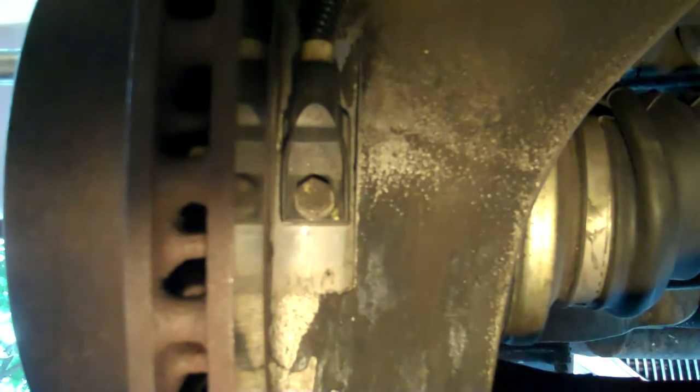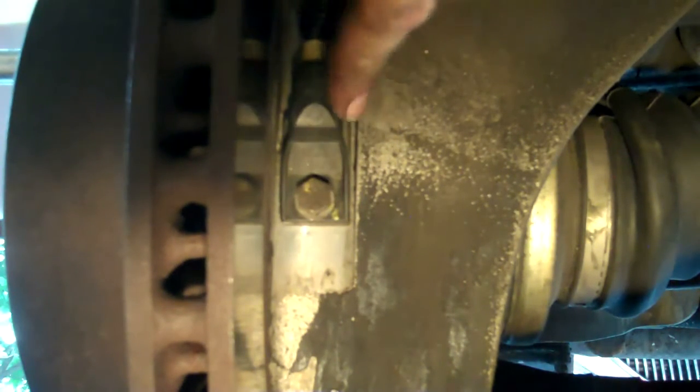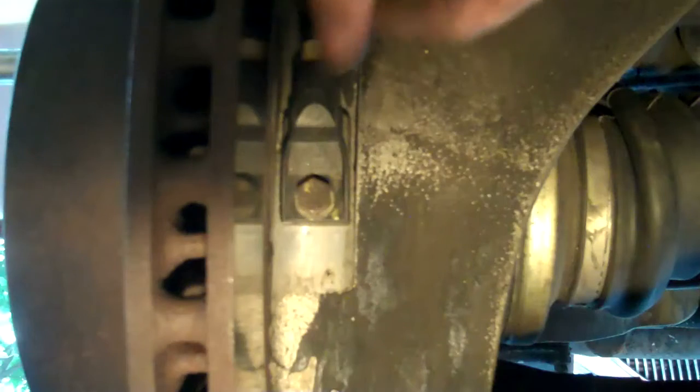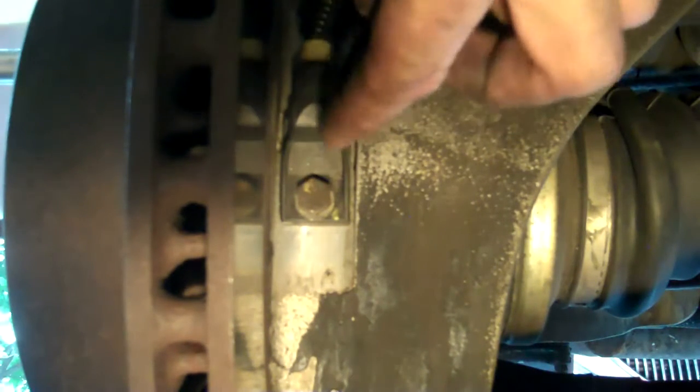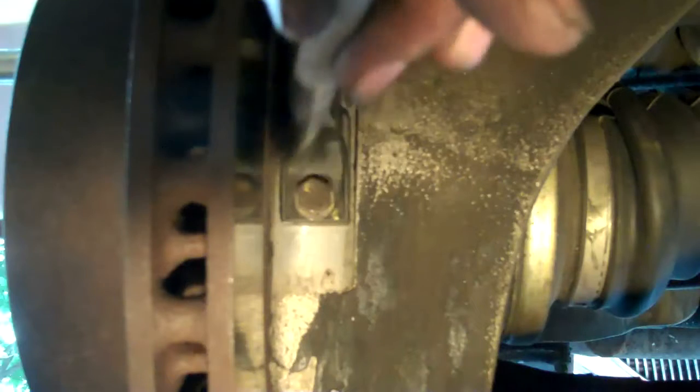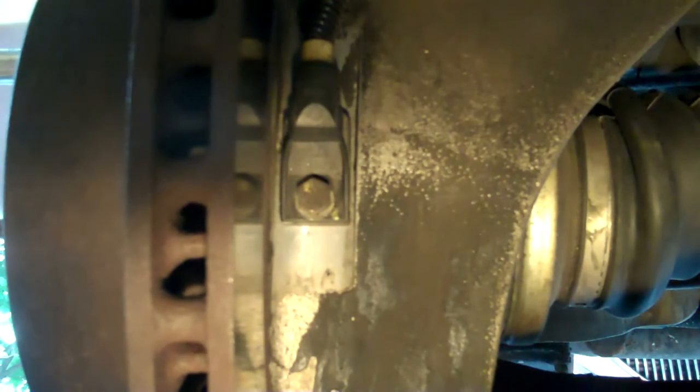For the rear wheels, the little sensor thing is here, so you just unscrew the nut. What I did was unscrew the nut and pull the sensor out. You could see the little reluctor wheel, the little ridges on it. So I used a paintbrush and some brake cleaner, stuck it in the hole where the sensor was, and just wheeled it back and forth to try and clean the little reluctor ridges. Because someone mentioned on YouTube about how even a little bit of metallic grit or anything can screw it up. So clean that off.